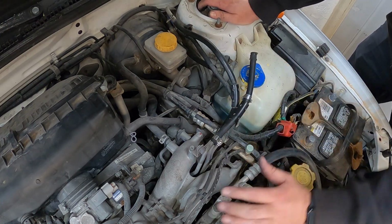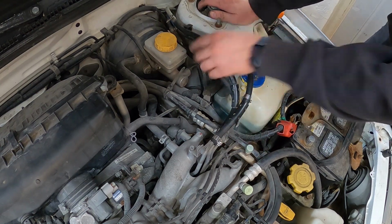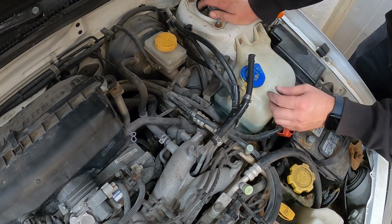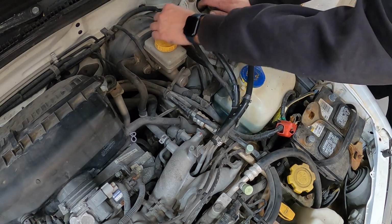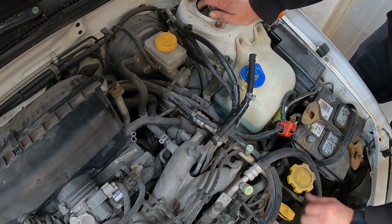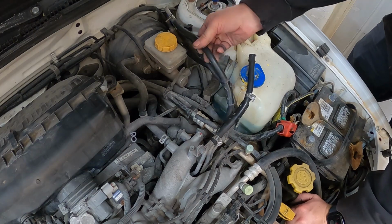So I think what I'm gonna do is run to the store real quick, get a replacement hose for here and here. Actually, I think I'm just gonna replace these three lines. I mean, we've got just the inlet, return, and then the evap line. So we'll replace the three from these hard lines here. It's the same thing, those little clamps there with the screws. Slide it off, replace them, because yeah, they're pretty bad. So we'll just get them all three replaced.